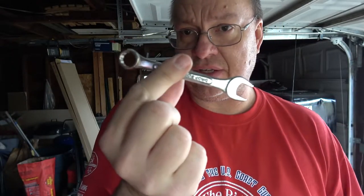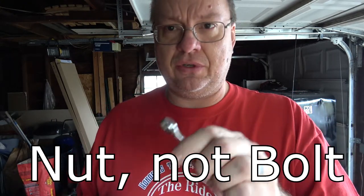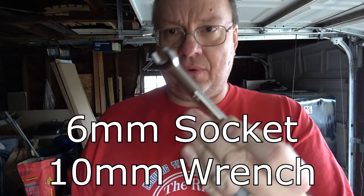That was easy. That was a six millimeter allen wrench. I also had a 12 millimeter wrench — they call them spanners in the UK — which I didn't end up needing, but it would have been used if the nut inside the fender was too corroded. To tighten the bolts holding the backrest onto the supports it's 10 millimeter, and I used a socket on one side and a wrench on the other. Then just a small screwdriver to pull those little caps off. That's it — job is done. Thanks for watching, see you on the road.